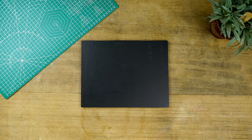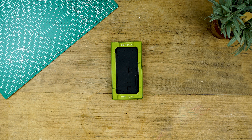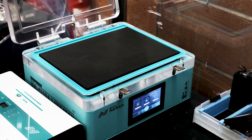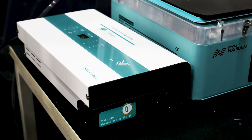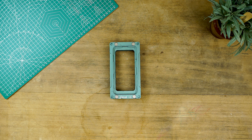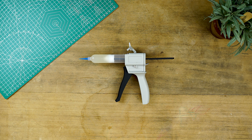You'll also need clean room wipes, a magic mat, a dust detection lamp, a Sam King lamination mold for iPhone X or XS, an iPhone X or XS touchscreen digitizer and top glass lens with OCA, a NASAN de-bubbler, a soldering iron, solder flux, tweezers, a lamination mold for iPhone X and XS, a replacement touchscreen frame, cold pressed glue and finally a glue gun.